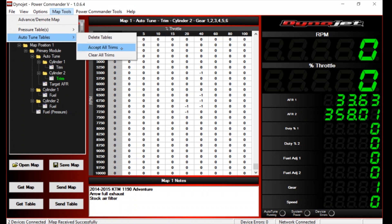What I didn't mention earlier is that this target AFR map shows all zeros up to 20% throttle all the way up to 6,500 RPM. I'm not sure that target AFR is going to be quite right for this bike - they do suffer with some drivability and rideability issues at small throttle openings. We can see slight changes to the map starting to happen. We can accept all trims - it was grayed out before - but I want to build a bit of a map so the customer can see it's working before we accept the changes.